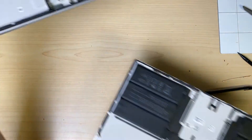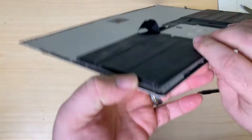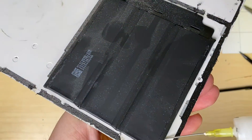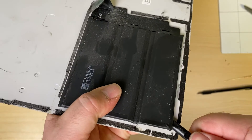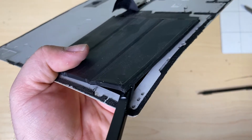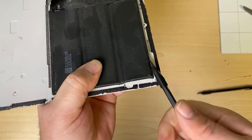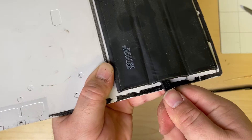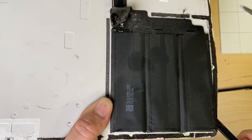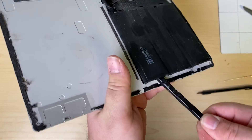Get out our new battery. Now for the fun part — removing the battery. What I mean by fun is more like annoying because it's more adhesive and more prying. Wedge that in there, add some isopropyl alcohol, and let the alcohol do its thing — it'll loosen up and break the bond the adhesive has. The last thing you want to do is puncture the lining of this battery, so be sure to use something that isn't going to poke or puncture it. Take your time and we'll be good.